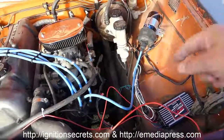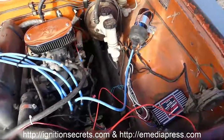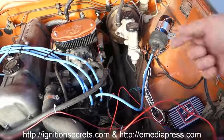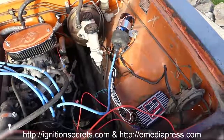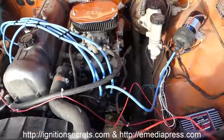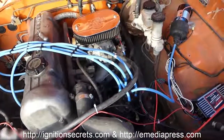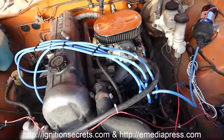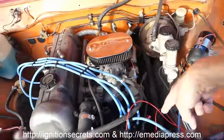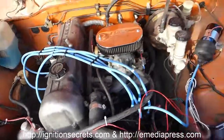But it's also a capacitive discharge, so it's a little bit different than just a regular 12 volt battery discharge. You're getting a more abrupt impulse into that, and the rise time is going to be really quick. You're going to get a really high voltage output of that coil. With the CDI, it could easily be 70, 80,000 volts, something like that. And then with no resistance in the cables, or bare minimum, they're obviously not superconductor cables, but right around an ohm or less. Whatever I measured on it before, like maybe 0.7 ohms for these long ones. So we're looking at 1 ohm from here all the way to the plug, and the plug only has maybe 3 ohms. So from the ignition coil to the plug, we're looking at about 4 ohms.